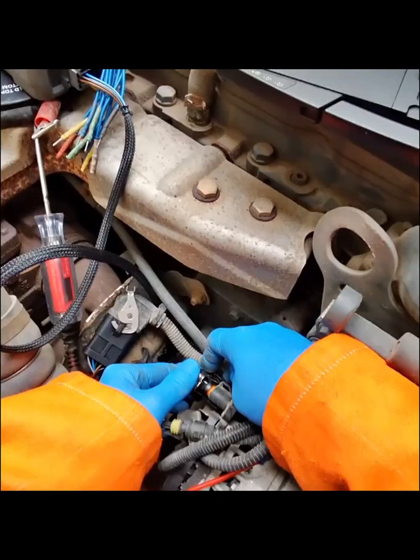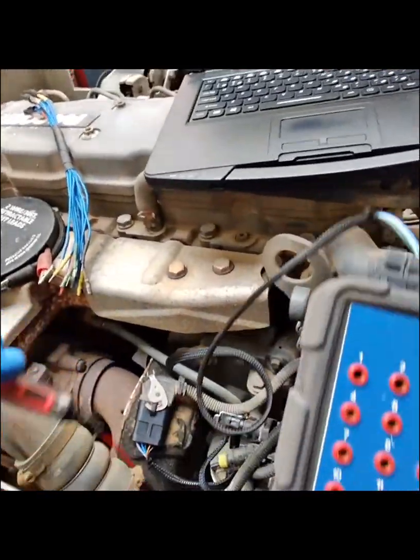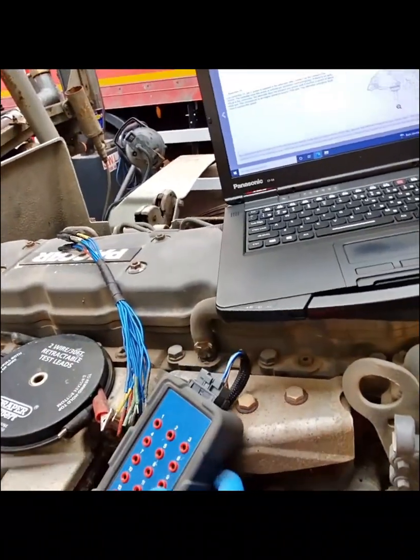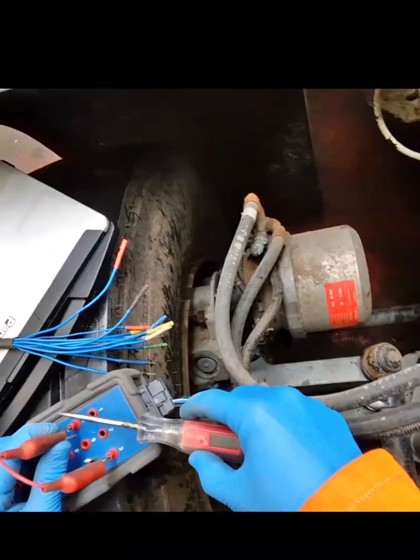This connection is connected to the power distribution on the side of the engine block with the midi fuse. The last connection on the brush pack is the L connection, which is pin 2. It's connected to VIC and also displays all the faults that can be detected through the alternator.